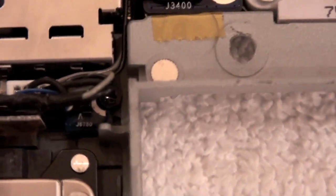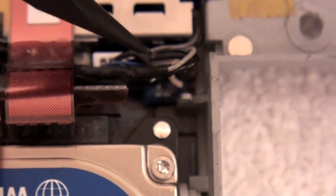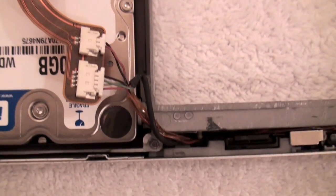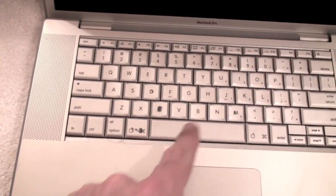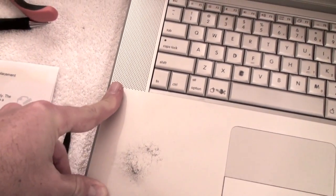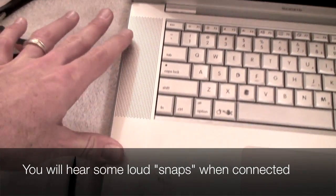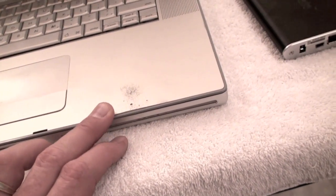Transfer the mounting screws the same way you see them in the old drive. These pesky little wires got in the way when I was trying to drop it back in, so just be really careful because all this stuff is really fragile. Watch out for these little guys here too. I've already reconnected all the cables inside and I'm just snapping this down — now this can get a little tricky. You have to push down on it, make sure you're on a good surface to do it, and then I have a trick I'm going to show once we get around to this side.